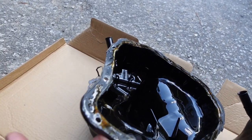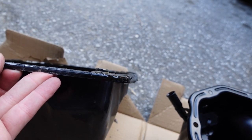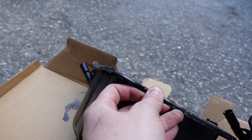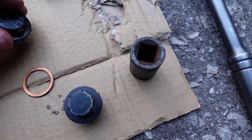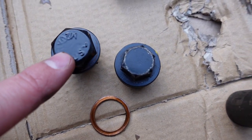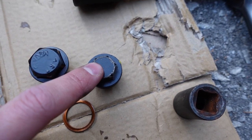You can see the sides where I was prying it up — because I pried it that way, I wouldn't reuse this oil pan, and I wasn't planning to anyway, but that method did destroy the sides. I do recommend removing the headers if you're trying to save your oil pan. I did notice one difference — it has to do with the actual drain plugs. The OEM one is a 17, the aftermarket is a 22. Not sure why they went with a 22.